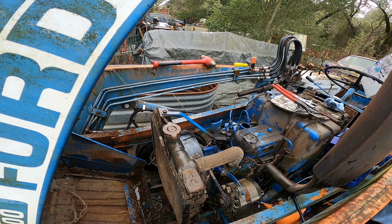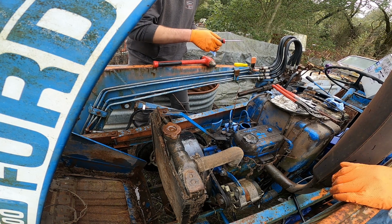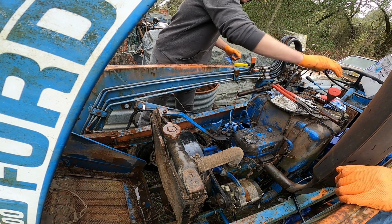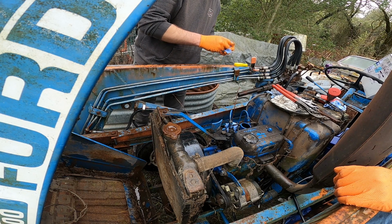And I smell... Oh, yeah, it's locking up. Is it? Yeah, I hear it just comes up. Is that hydro-locking? Yeah, that other cylinder's locked up. Here's the problem. It hydro-locked? Yeah, that oil's in there, and you can't compress that fluid, whether it be water or whatever else. It hydraulically has... not. So you do have to get that.